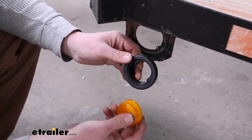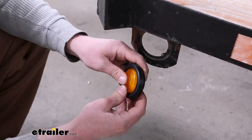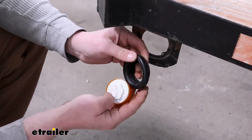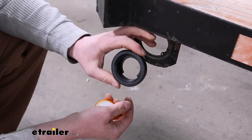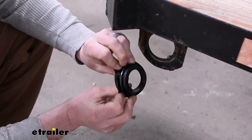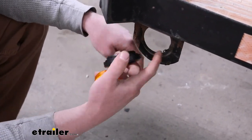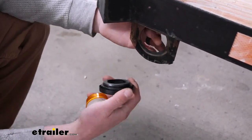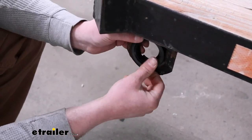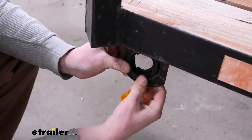In terms of what this is going to work with, you have your two-inch round lights, whether they're amber or red or whatever — those are going to pop in there, and it's a pretty tight fit. It holds that light good. The overall size is two and three quarters of an inch, and the part that actually goes into the opening is 2.32 inches. From my experience, these openings will be two and one quarter of an inch on a lot of trailers, and having that little bit bigger diameter allows it to push in and get a good bite.